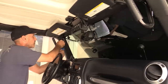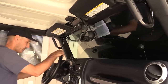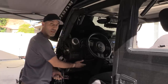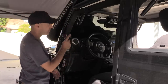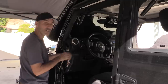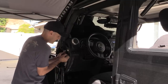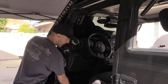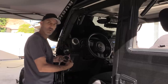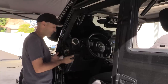Come on over here and we'll get this thing plugged in — it's been looking good. There are a couple of options: you can splice this into an ignition wire located under here and have the panel only go hot when the ignition is on. It defaults to the panel being hot whenever you plug these two in. I'm going to experiment with it like that and see if I want it ignition-switched. Also, there's a winch control pigtail — we're not gonna use that right now, so we'll just stow all this away.